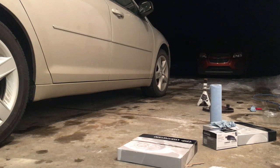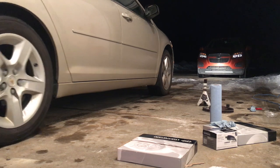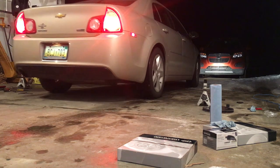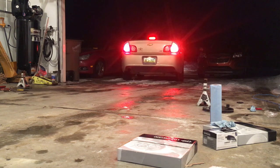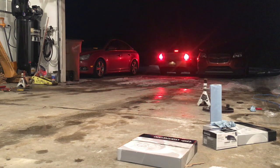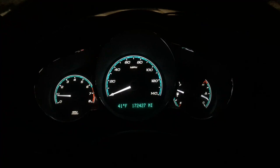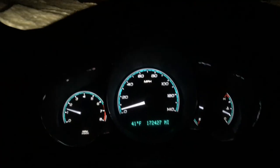Hop in the car. You might notice that the brakes are a little soft — just go ahead and pump them up a couple of times. That'll get the fluid and the piston to push out on the brake pad. Then drive the car out of the driveway. From here we'll go into the cockpit and give the brakes a little test, making sure they're stopping the way that we think they should.